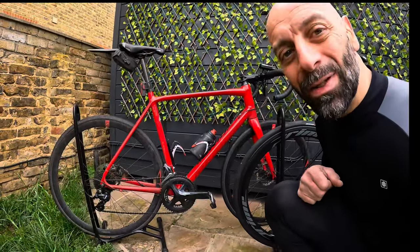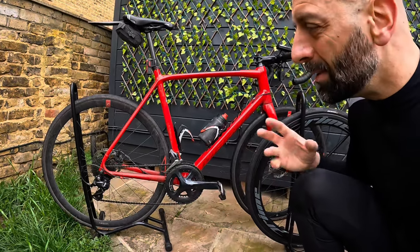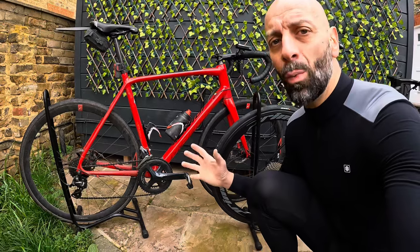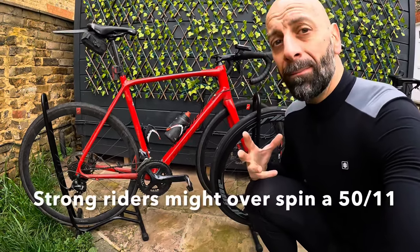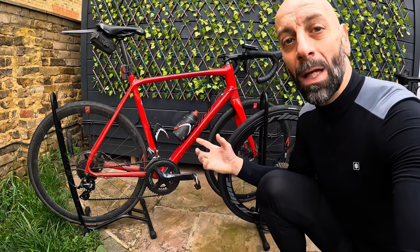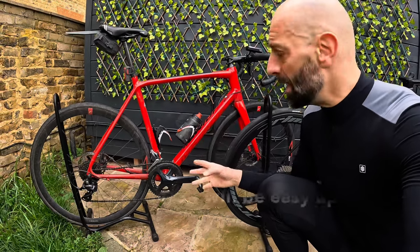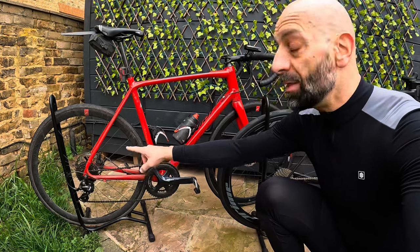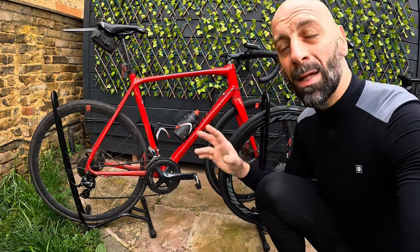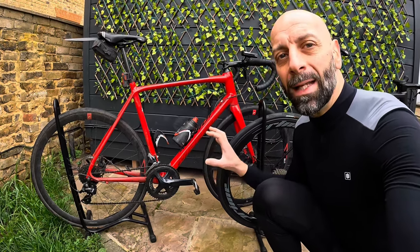As you can see in the industry, the compact chain ring — as it's known, the 50/34 — is used mainly on heavier bikes or for leisure use. You do have a gear here that will allow a wide range of ratios, but when you are at 50 with the 11, if you are quite strong, you might end up overspinning your top gear and not achieve the highest speed possible based on your engine and your muscles. At the same time, if you go uphill, maybe with a heavier bike like this, having the 34 ring combined with the 32 at the back will allow you to spin quite freely and conquer even the highest gradients. So this setup is a compromise to have a bike with a lower gear that is easy and friendly to spin.